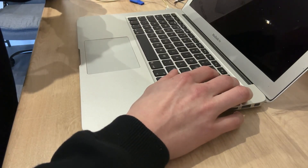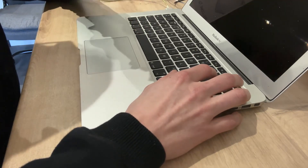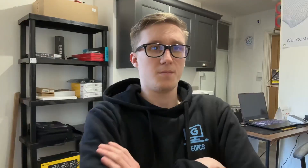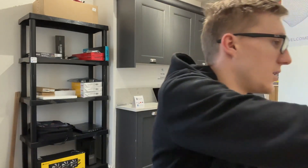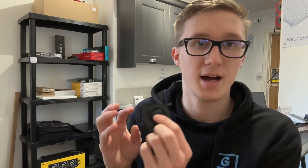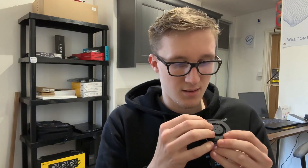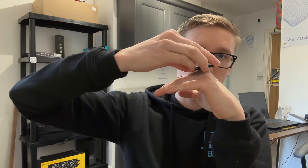So now what I'm going to try and do is get into the BIOS. The problem with Apple is when you start changing parts, the motherboard detects it and decides to get rid of everything. That's how you replace the fan on the logic board. This one does sound a bit more — what it was doing is when you put pressure on that and start to turn it, that's the noise it was making. And I actually think it is the fan — there's a slight cracking in one of the fins. It was the fan. I've just only seen that now. The antenna cables were running through it underneath the motherboard, so it didn't have that spacing for flexing. It was basically hitting that straight away, so when you start typing on it, it makes that noise.